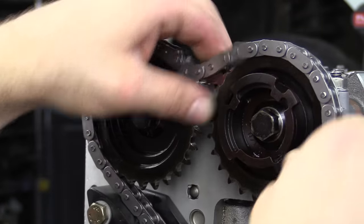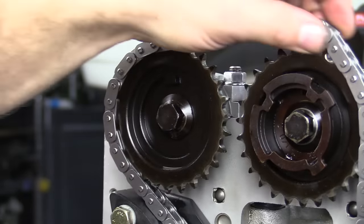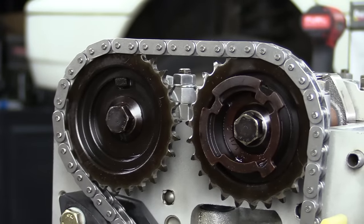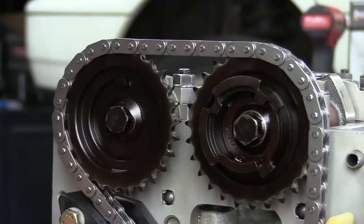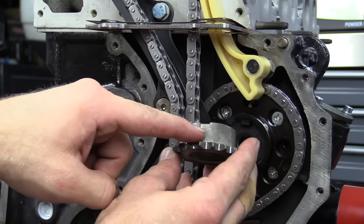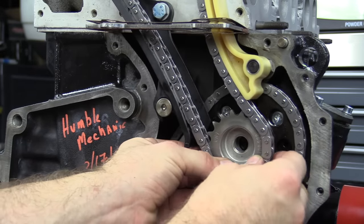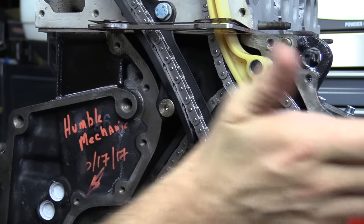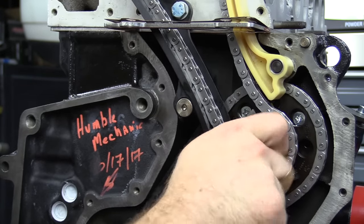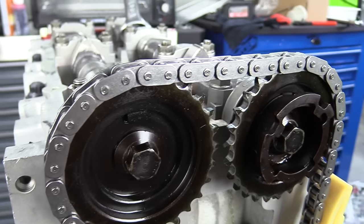Even though the chain is on and the cams are set, if there's slack between the two cam gears it is not correct. Any slack between these two cams will get taken up when we rotate the engine around and we'll actually end up with an engine out of time. So you do want that chain pretty tight between the two cam gears. If you need to take slack out, grab that 24mm wrench and move the cams so that you get the slack on the tensioner side, just like we did on the bottom chain. Now it's time to time the upper chain to the lower chain. This gear is also keyed to the gear already installed on the intermediate shaft, so as long as our first gear is timed properly we don't have to worry about timing it. Set the gear in the chain, find that keyway, and install the gear. You may need to tap the little gear into place — what you don't want to do is use the bolt to run the gears together, as that can cause damage.